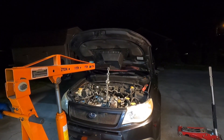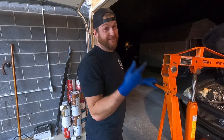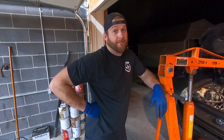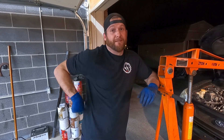How are we looking? We're looking good — the motor's in. We had one small issue we didn't show you with the dowel pin. The dowel pin on the driver's side was a little corroded and for whatever reason it didn't want to seat, so it had a little gap. We did a little sanding on it and it went right in. This didn't take us 30 minutes, not long at all. It's dark too, it's hard to see anything. Subaru motors are always pretty easy to take in and out. It's in — we just got it bolted up. It may not run but it's in. That's an accomplishment — we did something we told them we were going to do tonight. It's 8:39. We're going to take the chain off, fold this thing up, get it out of the way, clean up our mess, pull it in, maybe hook up a couple more things and call it done.